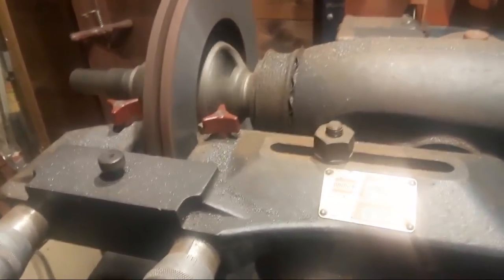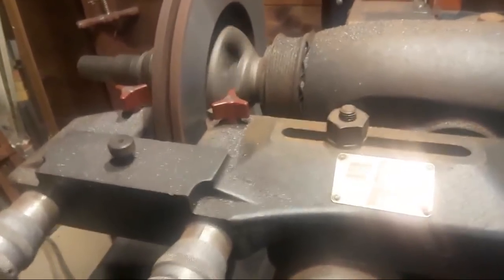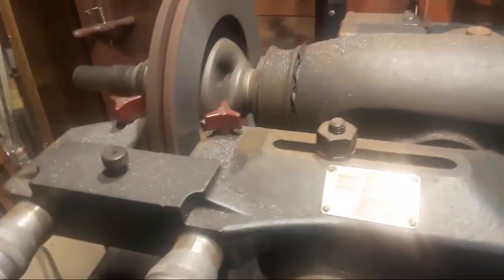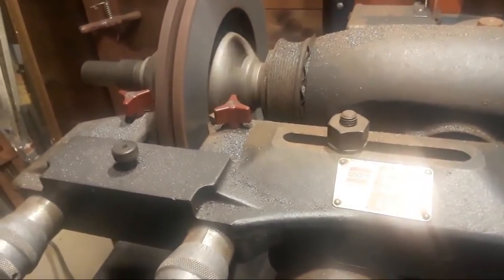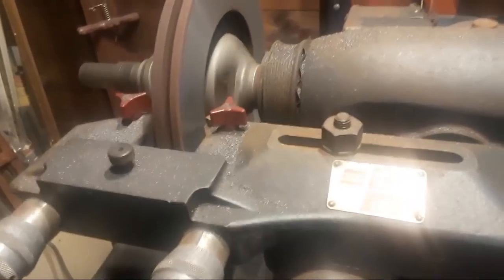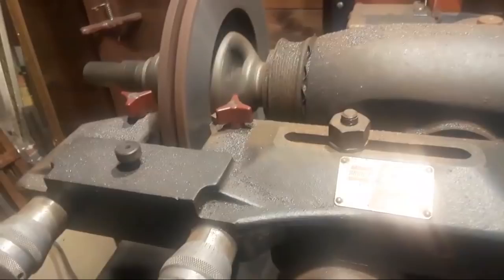Yes, Waukesha, your pedal may pulsate also when you step on the brakes. You also may notice a shimmy in the steering wheel. That's due to the rotors being warped and the caliper pistons moving back and forth when you step on the brake. If the warpage is in the front, not only will you feel it in the brake pedal, but you also may feel it in the steering wheel.